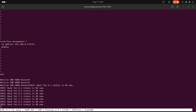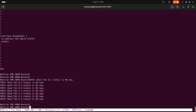In this video we're going to upgrade the BR-MLX-100Gx2. This is a 2-port 100 gig card from Brocade, or what is now Extreme Networks. So basically the customer wants me to upgrade this line card to match the same firmware version on the management module. So we are going to perform that.